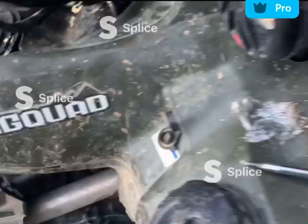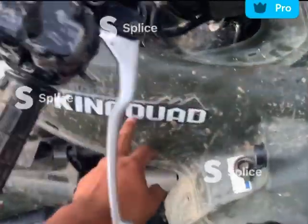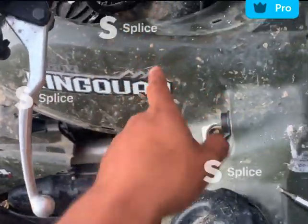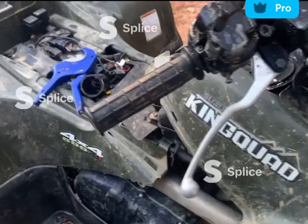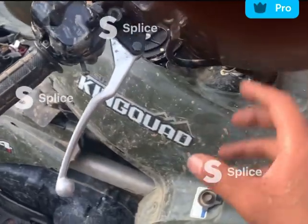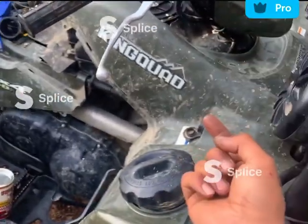I use a 2.5-inch hole maker. Pop the hole, put the male adapter on the inside, spun them together, and then siliconed it like crazy. And then I put Bondo. It was held by the opening because the male adapter had the 2-inch opening. Slapped it in, tightened them. I put clear silicone to fill in all the gaps on the inside and outside.